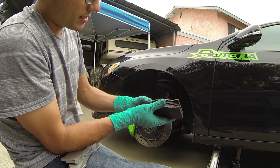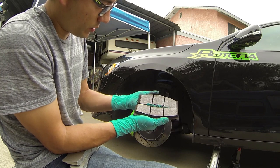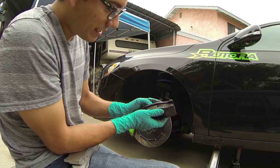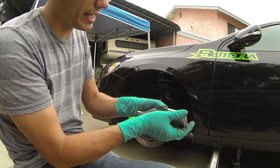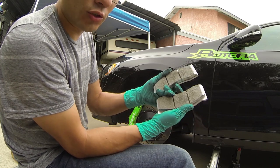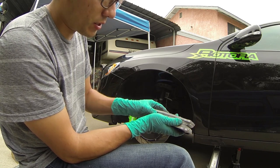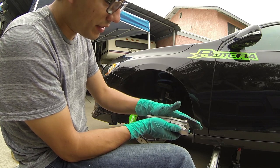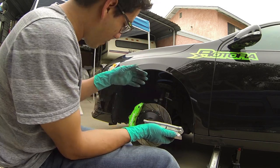So as you can see, these are our track pads. They've had a track day on them, a couple of fun mountain runs as well as our brake test, and they are doing phenomenal with wear — plenty of life. I would say there are an abundance of track days left. These are the street pads, brand new — the H2 compound. The track pads were the H8. These are great for low dust, low noise, and great initial bite as well. From our test video before, these stopped at 69 feet average. As for the track pads, well — I'll let you find out on that one.